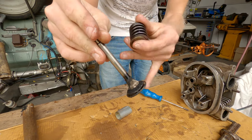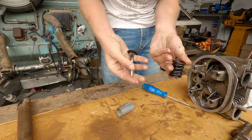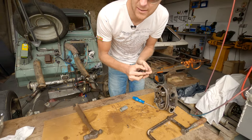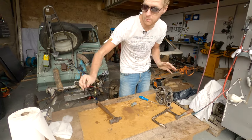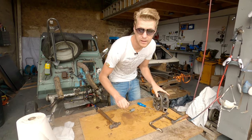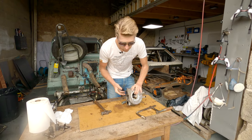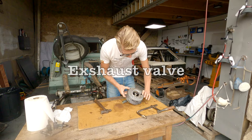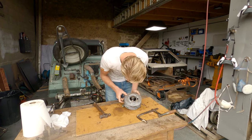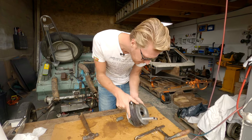And you can imagine how much that messes up flow. So once you've had the voltage issue and it's not running right because it's all built up with carbon, it's not going to run right. And this was the important thing about not just sorting out the spark plug, but actually sorting out the engine itself, because there was no point in me putting it all back together when your intake valve looks like it belongs in a reef. So the next thing to do is clean it all out.